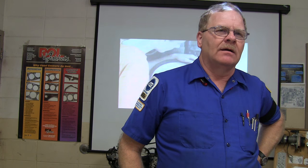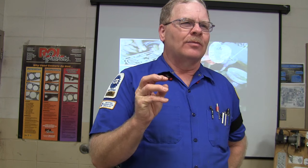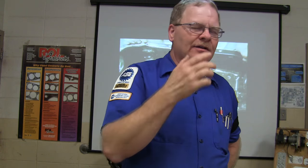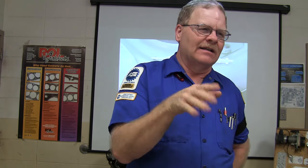And I told them, I said, are you packing your gas tank when you gas it up? She said, no, I always do that. And I said, well, quit packing your gas tank, and it'll stop doing that. Well, see, in the olden days, the canister purge only purged whenever you were into the throttle at the same time it was giving you EGR. Nowadays, it's liable to sit there when it's just idling and start purging.